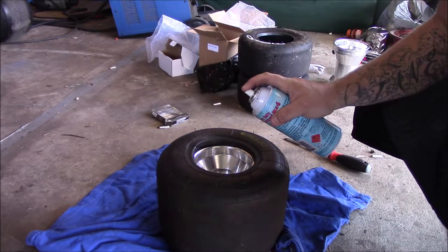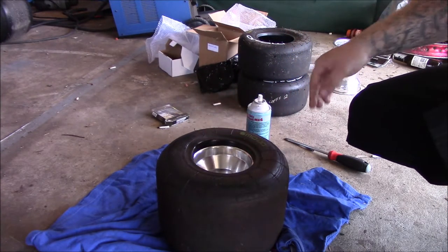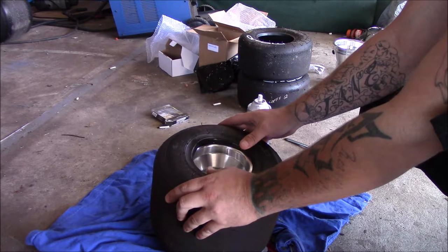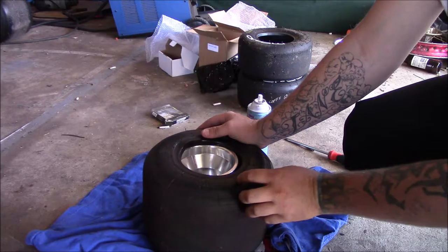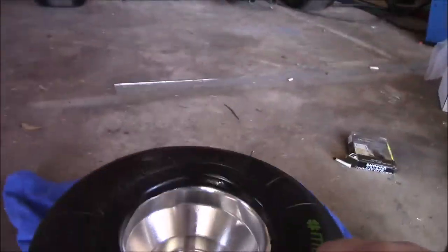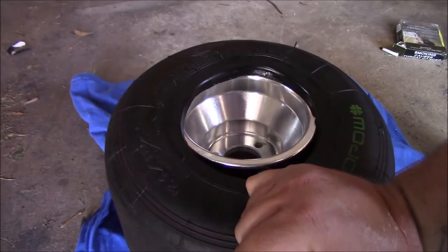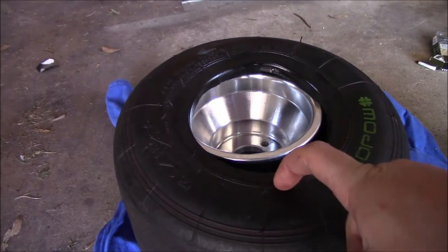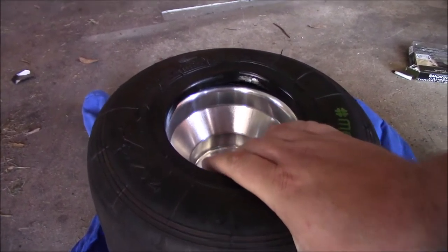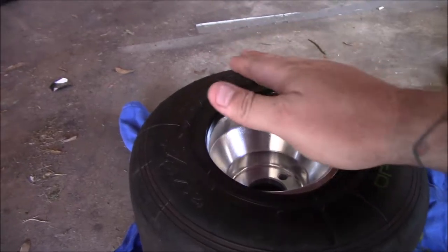The back bead is where it can get tricky, so we're going to give ourselves another little spray here — make sure we're a bit slippery. Now, this is a trick I learnt working at a local mower shop. Basically, what you want to do is push one side of your tyre down. We've got a bit of the bead hanging out there. We've got to try and push that tyre down and then inwards, so that this side of the tyre actually slips in underneath the bead, and then we pull it tight when we do that. That will put the tyre past where it locks onto the rim, and give us room to be able to pry this side of the tyre around.